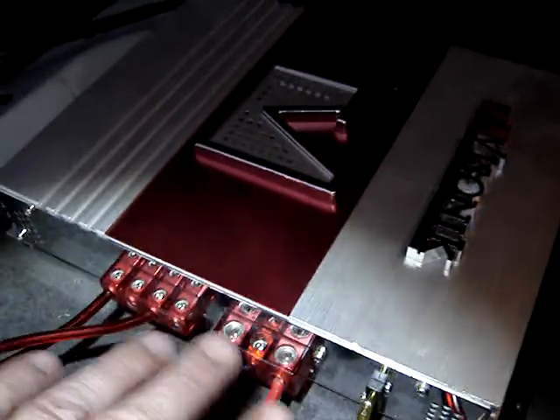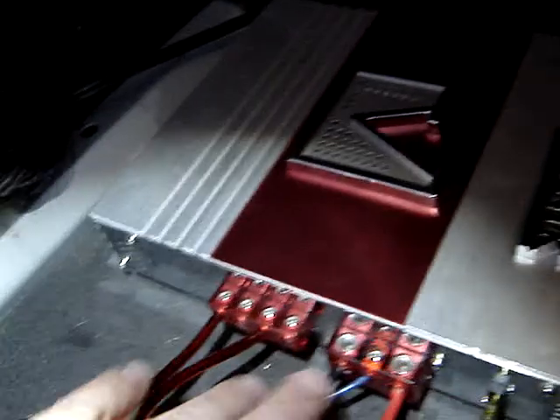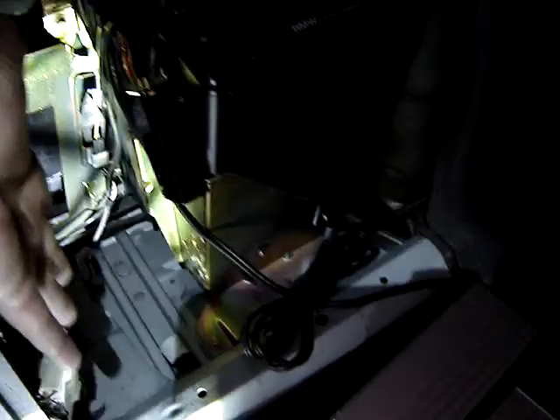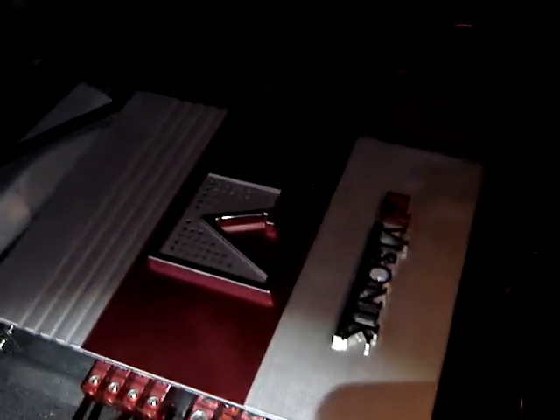This is an improvement from what it was — it was a lighter gauge wire, so I've increased the wire gauge and also shortened the length of it. But it's still mounted in this area here, mounted vertically and cable-tied into this compartment here next to the CD player. Ideally it would be closer, but the battery is just here, so that's how this is configured. Now let's look at the speaker wiring — this is important because this is where we get into the bridge configuration.